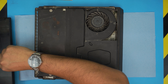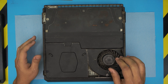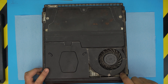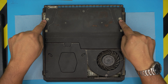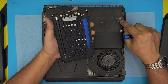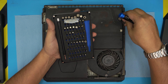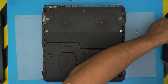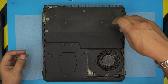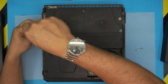We're going to grab some shop towels — about two sheets — and put them underneath to keep the workspace as clean as possible. Leave the removed parts to one side. You may want to put on some gloves. Up here you have the fan, and it is really dirty — it looks horrible. I can see all the dust accumulated on the sides. We're going to use an iFixit screwdriver set — a Torx T9 with a security lock, and a Phillips number one.